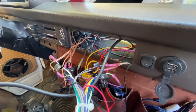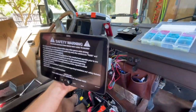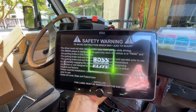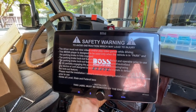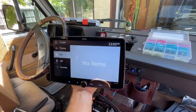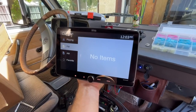I've got all my wires connected. Before I put the receiver into the mount, I like to go ahead and power it up to make sure it's working first. I'll flick that switch — the stereo turns on and it's powering up. I still got the plastic on the screen. Everything's working fine. I also like to fire up the engine and listen to make sure I'm not getting a huge whine — I think this one has a noise suppressor built in. Everything checks out, so I'm going to get it installed into the dash and call it a day.